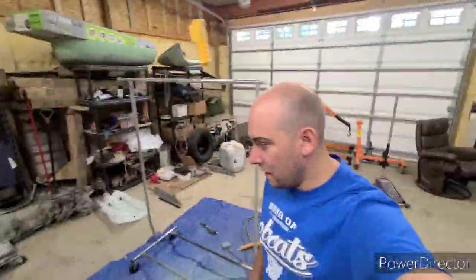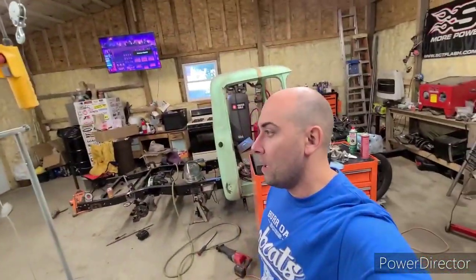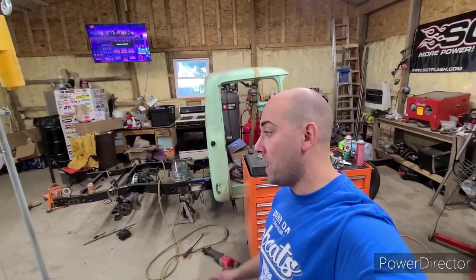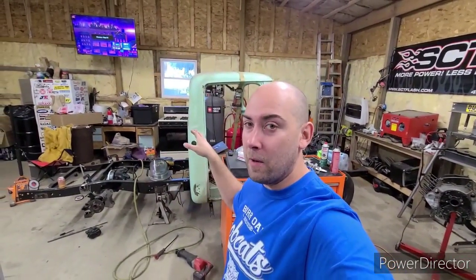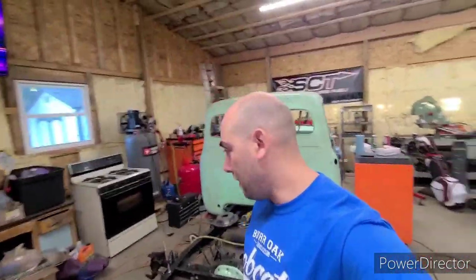Got the part loaded in there. Got it off the rack. One thing I want to mention is, before you start coating or doing anything, make sure you run through the whole process like a dry pass. Run through, make sure you can get from your coating area to your oven without bumping anything, without running anything over, without tripping on anything. Make sure that your part can get into the oven without bumping anything.